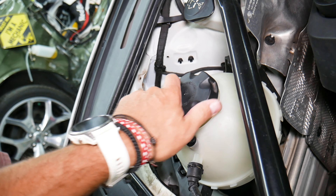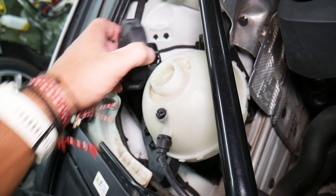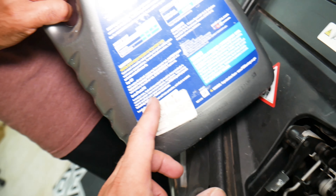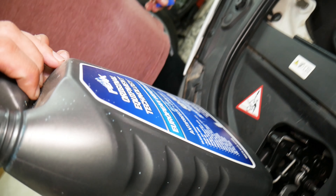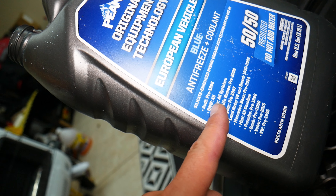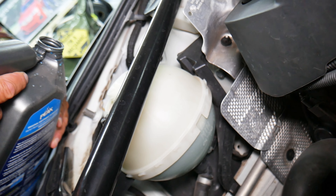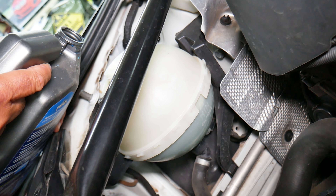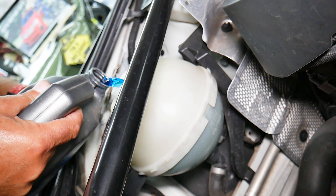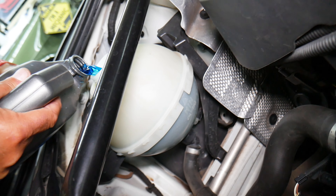We're going to go ahead and do that. By the way, on this channel we have videos about every single fuse on that BMW 5 Series — about 270 to 290 videos. The coolant that you need to use needs to be approved by BMW. We recommend only original coolant or one approved for European vehicles that is compatible with BMW. Do not spill it if you have pets — dogs, cats, kids, anything little running around. Don't let them come close to coolant. If they lick it, they can get severely sick or die. It's very poisonous.